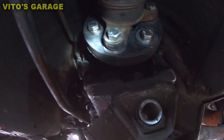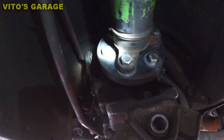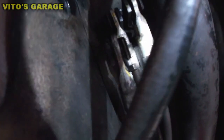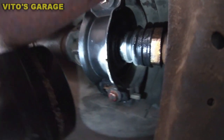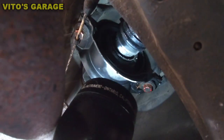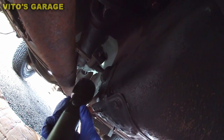There's our brand new flex disc in the front — quality parts made in Germany, new bolts and hardware. When we go back here there are the transmission shifter bushings we replaced — actually really easy to replace, a lot easier than on an automatic trans. Right here we have a brand new center support with the center support bearing, and I added this boot that was missing. That's your drive shaft — and going back there I'll show you the rear flex disc.